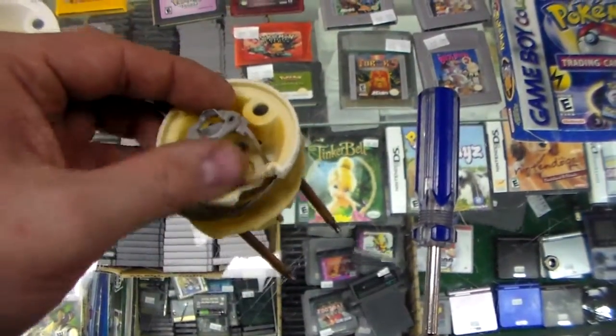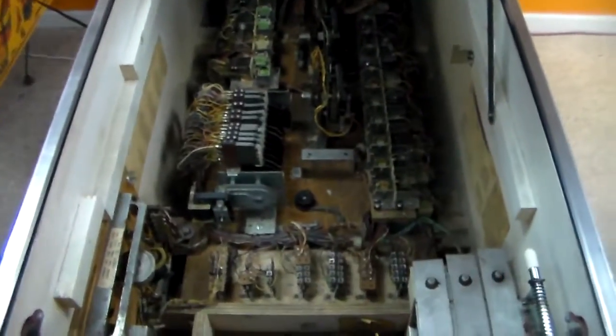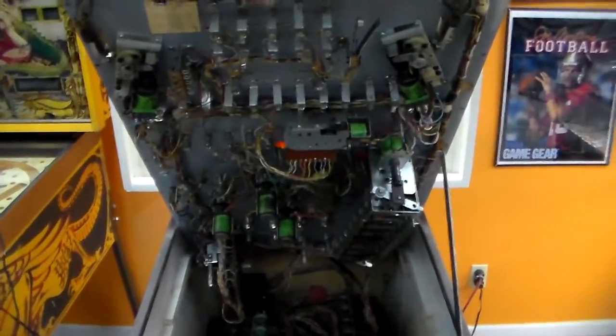I forgot to get new sockets — you can get this whole piece new. So I'm going to have to clean that one up and adjust it to make sure it still works good. Let me show you under the playfield so you can see how that looks now that it's been removed. You can see what that little piece on the skirt sticks down through there. Whenever it hits, it connects the two switches, which makes the coil pull in and pulls the metal. Now there's another switch there that connects at the bottom — see that? That gives you your hundred points; it knows you scored because that switch connects.